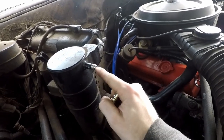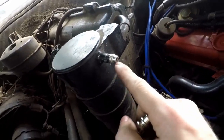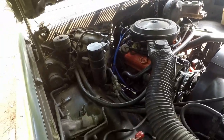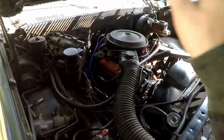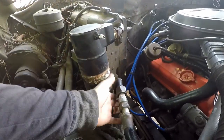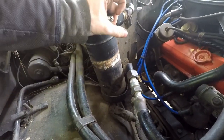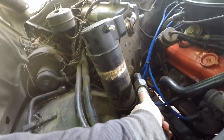Mine's not coming out of here — there's not enough of an opening to pull it out. So we're going to just replace the dryer now. We were going to do it later, but we might as well just do it now. And if we're going to do that, I might as well just put new O-rings everywhere since I have them. So take the dryer off — just two nuts. This one you had to use two wrenches to get off. It's tight in there, so we gotta wiggle it just right and then it will be able to pop out.